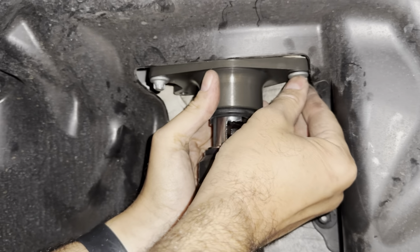Okay, now we're going to tighten the camber bolt. That is 165 newton meters or 122 pounds foot. Oh, can I even get in there at that angle? This is going to be a pain. So trying to hold it in position. I basically just set it for maximum camber right now. So we have to go get this aligned, because the toe is going to be so far off. And we flipped it around because you want to be tightening the nut, of course, not the bolt, when you crank stuff down like this.